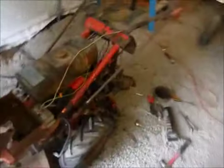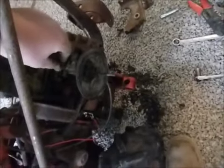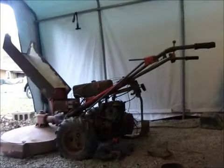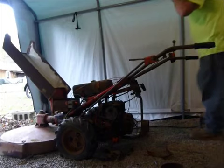Alright guys, I just cleaned the carb on the 526 and I have it running a little bit. Here's what I got out of the carb. Down there I pulled the main jet out and cleaned it. Actually, we'll go another quarter turn out with the main. Just had it sort of running a couple seconds ago. Let's see what it's doing.